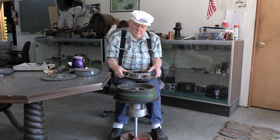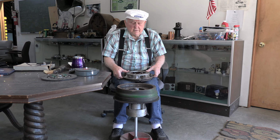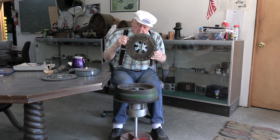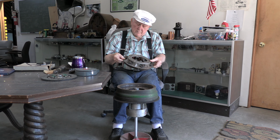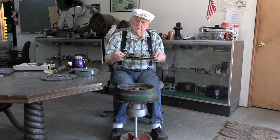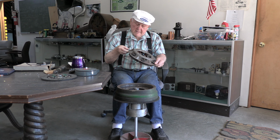You have to put it all together. You have to get all 12 springs in, and you have to put pressure down. It's not a very good idea to try to take it apart, and really there's no reason to. The springs are basically all set at the 100 pounds of requirement. So if you take it apart and want to put one back together, you'd have to measure each spring so that the spring coefficient is the same on every one of them, and positioning those.